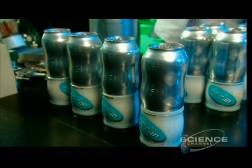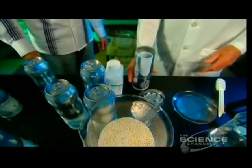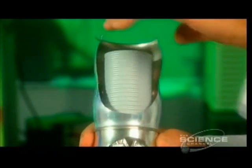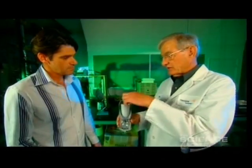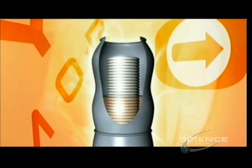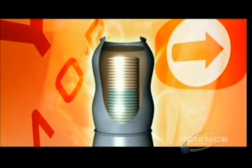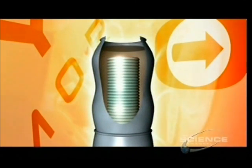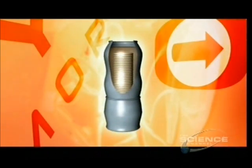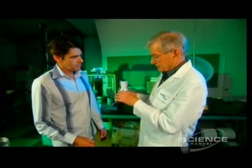While our scientific experiment chills, it's time to get inside this four-minute fridge and see how it actually works. The refrigerator consists of three components: a heat absorber, which we call the evaporator, because a vapor is formed inside of it, and it sucks heat out of the beer. The evaporator surrounds the beer in the top of the can and contains a watery gel. Twisting the can releases the vacuum stored in the bottom of it, sucking water vapor and heat from the gel to the base of the can. The vapor then flows down into the lower section where it is absorbed in a material which absorbs water vapor.